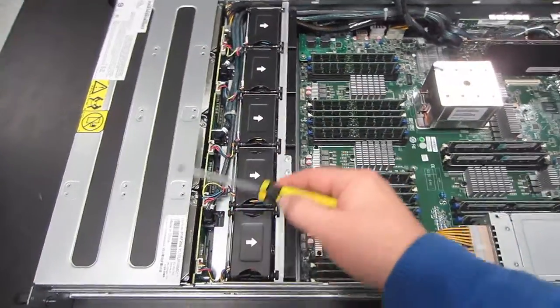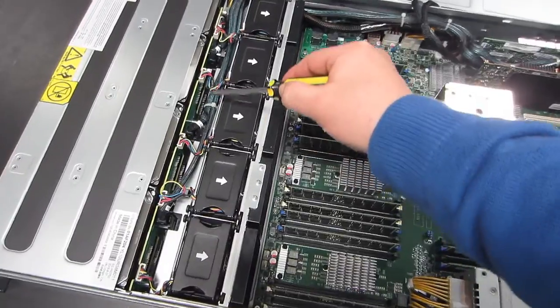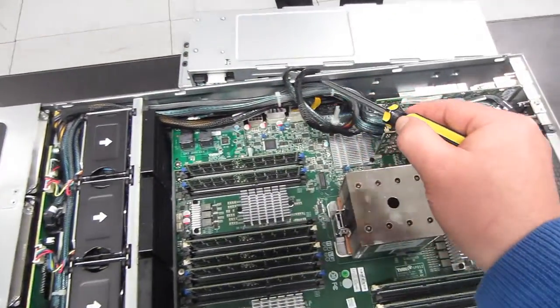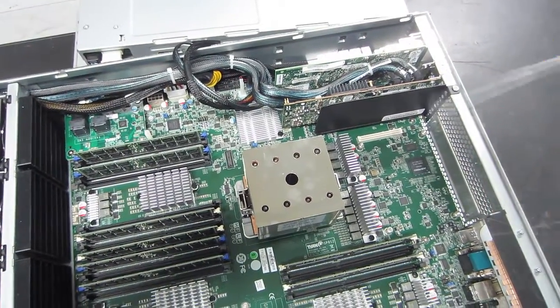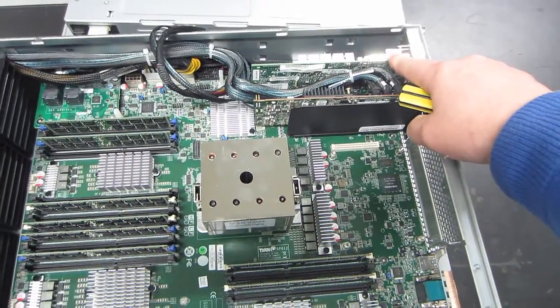At the front you can see all the disks and the backplane with its cables. There are five fans — they're not hot-swap and you can't get into the machine while running. The bluish-green-black cables run over to the SATA controller — an Adaptec unit. This is the simple version that does RAID 1 and 0.